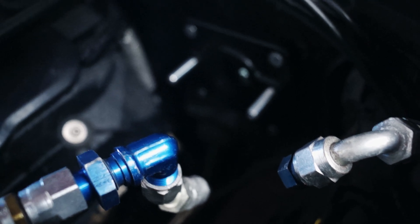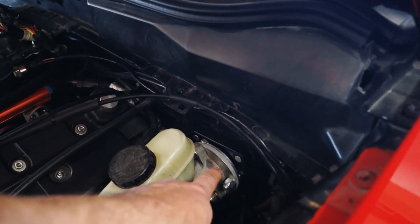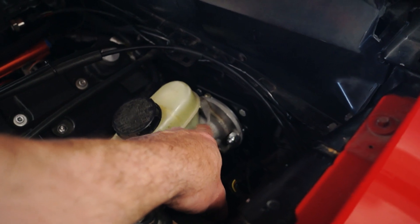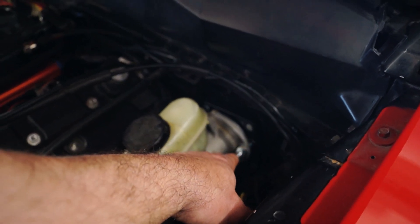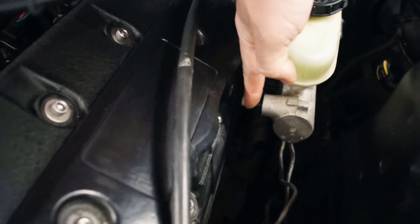The car will have power steering but with manual brakes until my manual rack comes in. The manual brake conversion is all done — brakes bled and all that good stuff. I made one cool bolt pattern style master cylinder adapter because Maximum Motorsports had a horizontal pattern, originally for the 94-95 car, but with this being a four-valve I didn't want the brake lines beside the valve cover. So I made an adapter for the vertical style brake lines. I can swap between the two if I want, but I'm leaving what's in there and running with it. Let's take it for a cruise and see how it does.